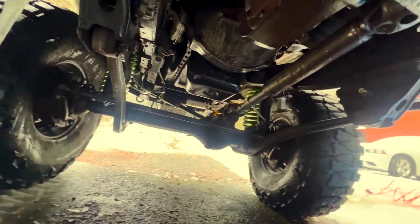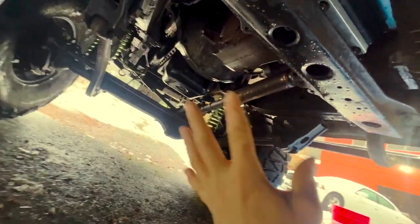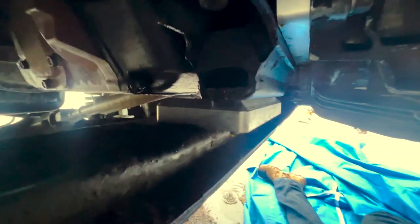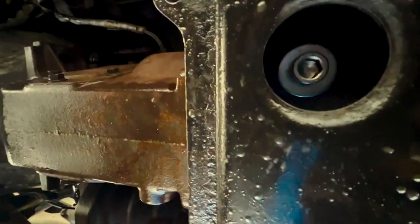This is acting as a buffer between the NV4500 and the Toyota transfer case, and it basically moves the mount point back — just a little further back from the stock mounting location. That means my front driveline is extended a little further than I'd like, and my rear is compressed a little more than I'd like. Might get these retubed — probably going with super duty one-tons out of an '05-plus with the 35 spline that you can put the 1550s on. You're going to need some way to move your mount back a little bit. This piece is made out of machined aluminum with a recess for the Dodge bolt holes, a nut in there, and provisions for the hardware that goes through the crossmember. Really a huge fan of that — everything is working and I've confirmed that everything moves correctly.